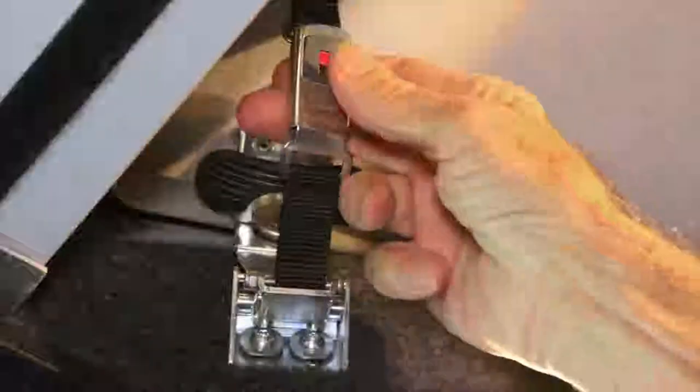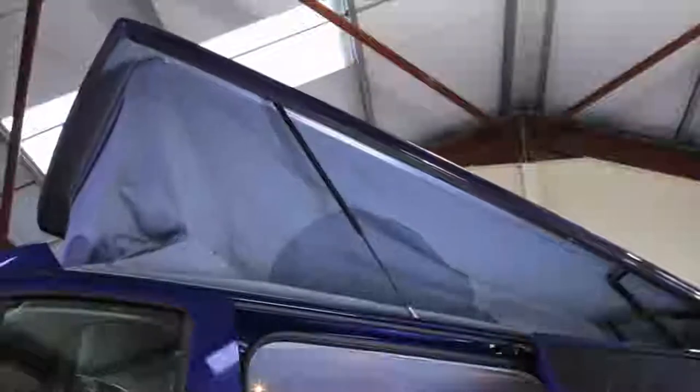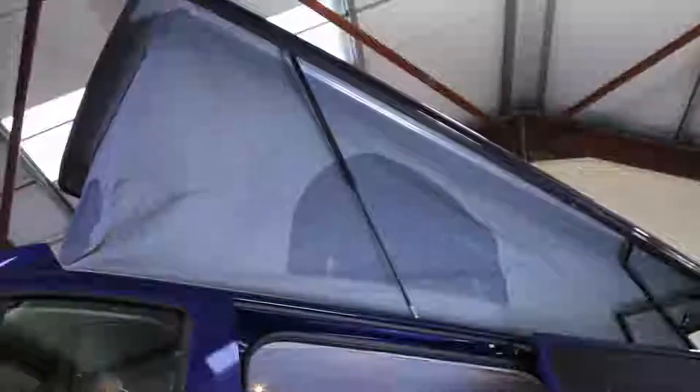Points to remember when you're raising the roof. First of all, detach the sound deadening panel off its velcro strip — it's there to reduce wind and road noise when you're driving. Let it hang down. Next, remove the two safety straps, turnbuckle the catch and release the two catches, then simply push the roof up. It'll go up on its gas-assisted struts. Push the bed up into the roof itself and you're ready. Finally, roll up the sound deadening panel and clip it in place.